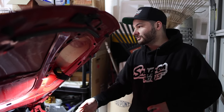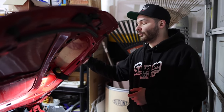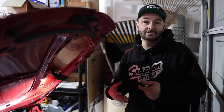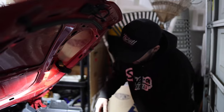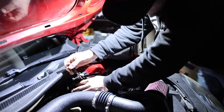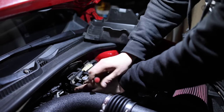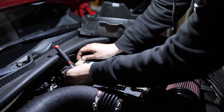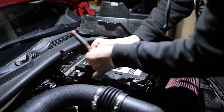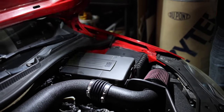The first thing we're going to do — you don't necessarily have to, but I like to disconnect the battery because we're going to be fooling with pillars and upholstery that's right next to airbags, the side curtains. So I advise taking off the negative cable and just setting that to the side so we have no power to those airbags just in case you puncture something. Just a preventative little thing. Put this cap back on so it can't physically go back on.